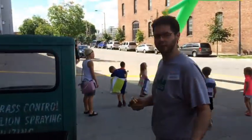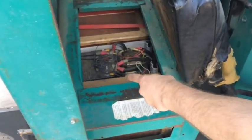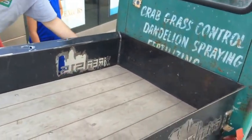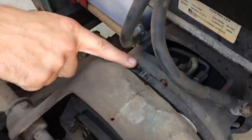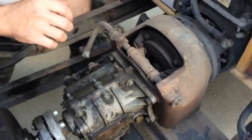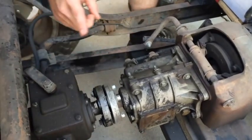Underneath the seat is where the engine normally resides. We've got batteries on either side — you can see the motor controller there and the big relay that literally clunks when I turn it on. We made an adapter plate for the motor, and when the motor spins it directly drives the clutch, so the rest of the drivetrain doesn't know the difference. We had to add a crossmember to bring the transmission back.